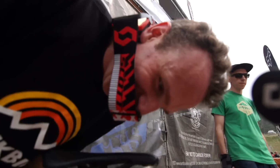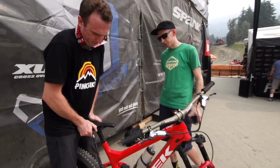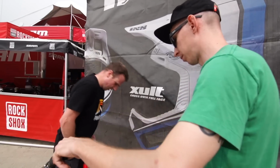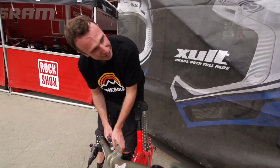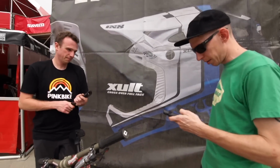Just start cycling it at 70. Usually I just give it a push just to break through that negative. As long as it's not hard to push, because otherwise if you wait until you're at the end, you can do it, but it's just a lot harder to push through. Then check and see what it says now. 162? So put it at 165, because that's what you want it to be. Cool. All right, so both are calibrated.